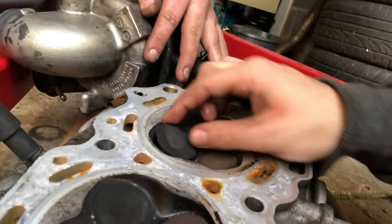With the Subaru, I need to send the heads away because I haven't done so yet. If you haven't seen the video of stripping the heads down, a link will be in the description below. I've got to send them off because one of the valves was stuck open, as you saw in the video. There's a local company that gave us quite a good deal on it, and we're planning to get some inside footage of the actual workplace to show the process. I've also bought myself an engine stand so I can flip the engine, because I need to replace the piston rings — I had a problem with compression and I want to eliminate that issue completely.